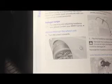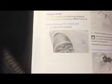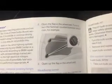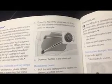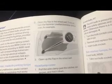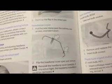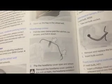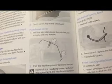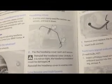Alright, let's get busy. It was kind of cramped for me to show you, but basically you're going to take your tire and turn them to the outside, as I did there. That's going to give you a little space to reach in and pull off the cover, the flap. Real easy. There's two little tabs that you can take a coin or a screwdriver and just give them a turn counterclockwise and it'll pop right off. Then inside there is a wire that you can see going across the back of the housing, and that needs to be removed by pulling that little metal wire down off of those catches there, and then you'll be able to take the cover out.